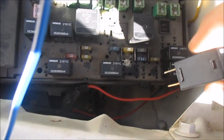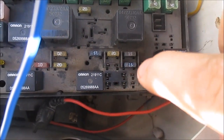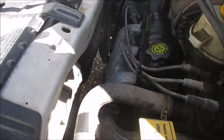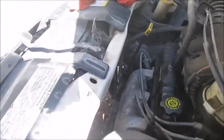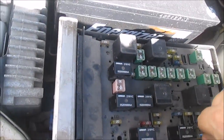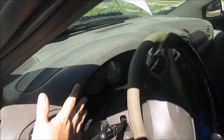I've got one wire plugged in at the lower contact and the other caddy-cornered across to the top — plugging them in now. That should kick on my compressor — and it does! It kicks on. To add refrigerant, I'm going to hook up my refrigerant and turn it on. Actually, let me see if it's blowing cold now — which it's not. It's still low on refrigerant.